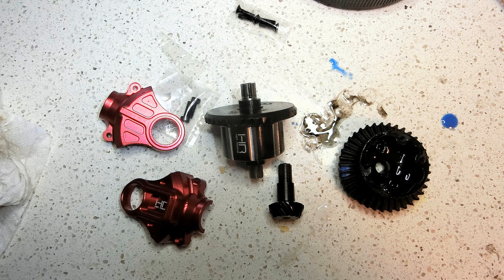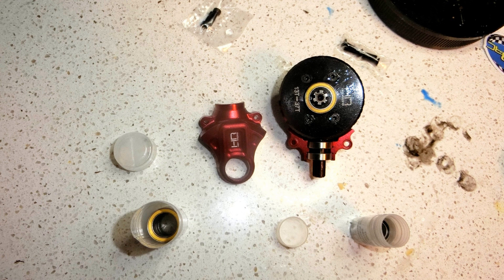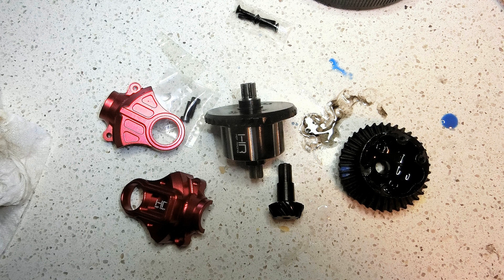When I received the ordered parts and gears there were no instructions included, so I went back to the YouTube video and began the conversion to install the new gears. You must take the existing internal diff gears from your existing stock diff case for reuse in the new install. I had ordered the new aluminum diff yoke, assembled all the gears, followed the directions from the YouTube video, and installed the completed diff box back into the rear section of my chassis.